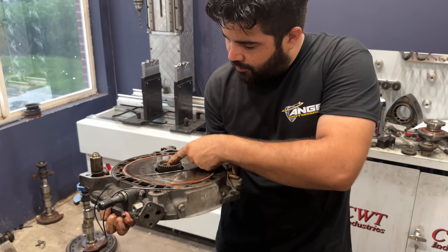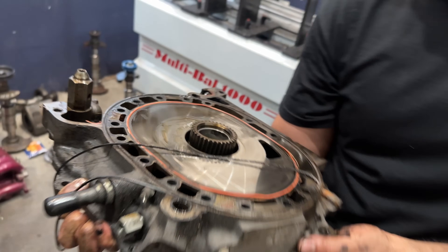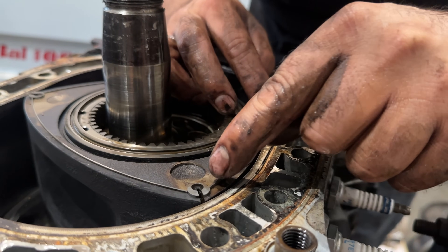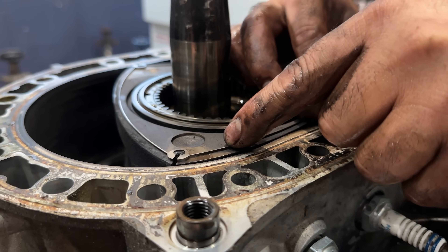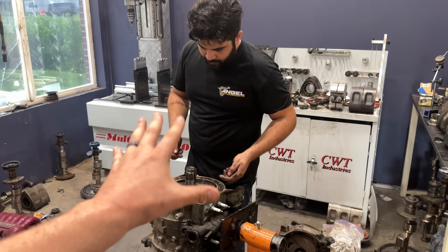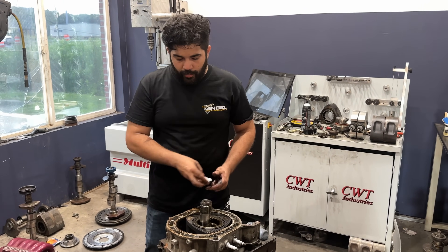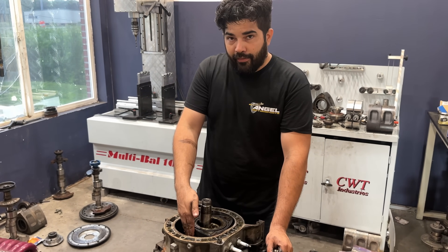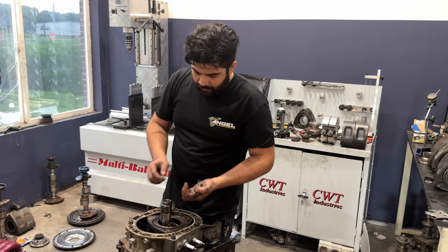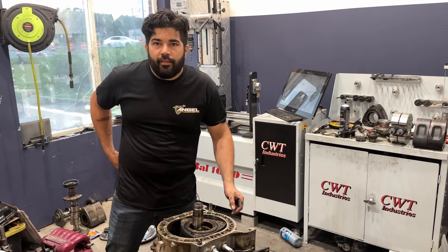No copper. A little bit of wear down here — that's probably from the rear counterweight that they put on it, might be a little bit off balance. See the gap between the corner seal? No bueno. So that causes low compression. If we had done a legitimate compression test, something like that would show up — this one will have good compression, this one will have good compression, but this one's going to probably have 10 less. This is something that can happen directly from Mazda, because they're on an assembly line just picking stuff from bins.